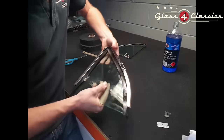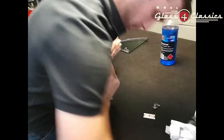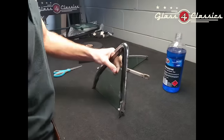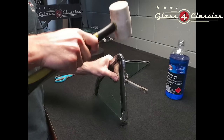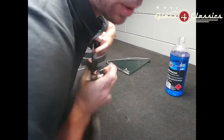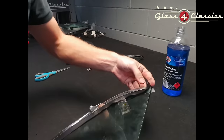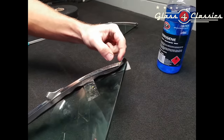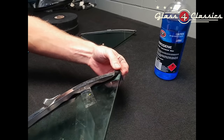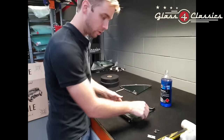We're going to go ahead and push this into the frame — it's going to need a fair bit of force to get it in. We use toughened glass so we've got the ability to give it a knock with a rubber mallet to get the frame onto the glass. If you're using laminated glass, as many of the American classics do, you do need to be careful because if you thump it with laminated glass you're going to end up with it breaking. Make sure you measure how far the glass was protruding from the frame before you start the job. In our case this is correct — that's how far it sits out to seal against the front vent window rubber.